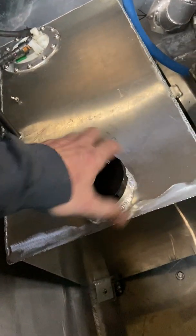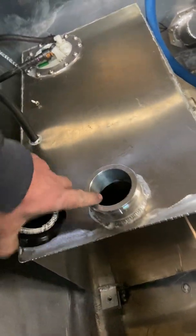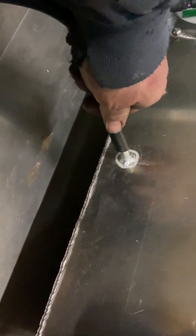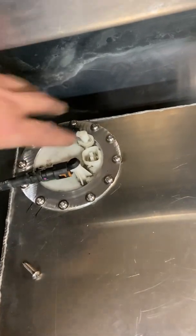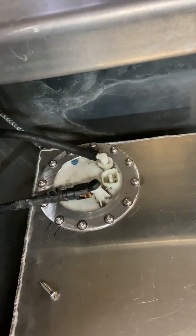On this fuel tank, RS Racecraft sells these little filler caps that are pretty nice — heavy duty, big opening for filling. That was one of the easier parts. I made my own vent line just out of some straight stock and put a little flange on the end for a hose clamp to grab onto. The bigger issue was making something that fit the Honda main pickup, the return lines, and the sending unit.